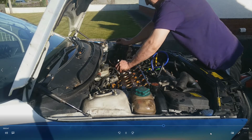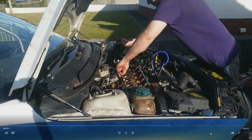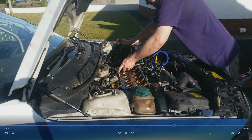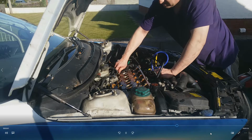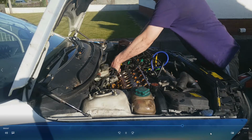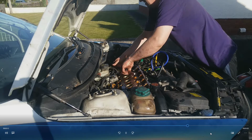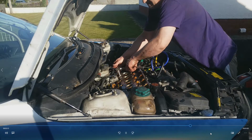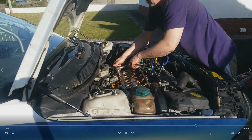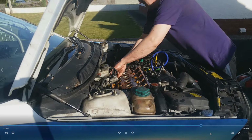So I remembered my Bosch blue construction bits, I think that's what they're called, and they'll basically drill anything: masonry, timber, plastic, construction, steel. So I got a 12mm one, put it into the cordless DeWalt, and she just cut through it like butter. I got the dual mass flywheel off, and then I was looking at it and it had some rotational play, it would jiggle about, and I thought, oh, this isn't good, I'm going to have to pay a fortune for a replacement dual mass flywheel.